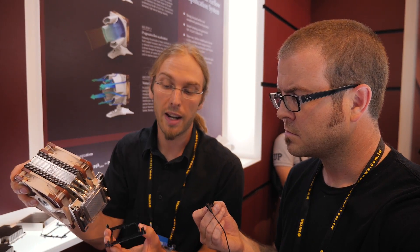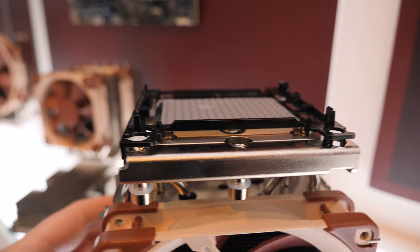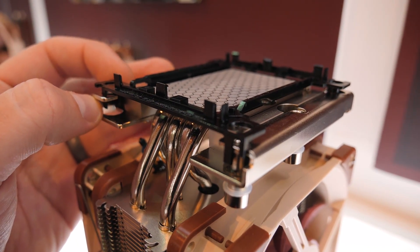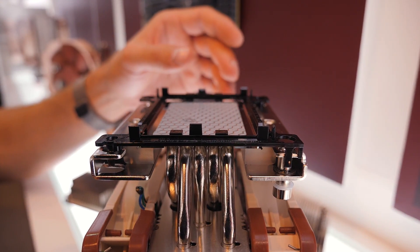That sounds pretty straightforward, but you will really have to make double sure that the CPU is firmly snapped to the processor clip, because otherwise you have the risk that the CPU could fall down into the socket, which could damage it. LGA3647 motherboards tend to be very expensive, so damaging pins on a $300 to $400-plus motherboard is not a good time. When Threadripper came out with the TR4 socket it was a more advanced installation method, but here you're clipping the processor to the cooling solution and then dropping it into the socket, which seems like it might have some potential for end users to damage it — possibly not the most user-friendly solution.